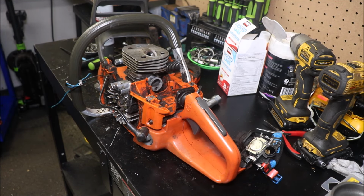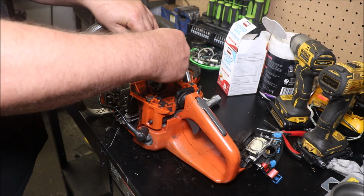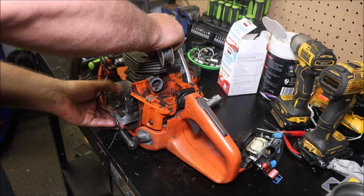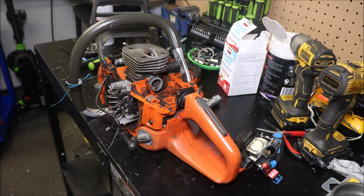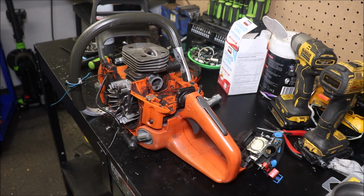You know, I know how they perform, like full tilt. I've done several of the 353 style cylinders, done several 346 styles. You can get them to run pretty dang spicy. I've done one with the cylinder, and I think the seller I bought the piston ring from kind of ripped me off, sold me a used ring, because it never would seat in and build any kind of compression at all. I have that piston and cylinder over there already. If I wanted to just go get that cylinder and bolt on this, I could, I guess. It's already ported, ready to go.